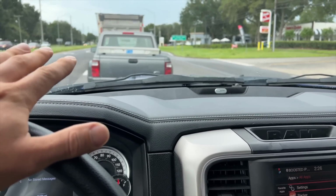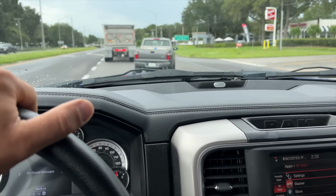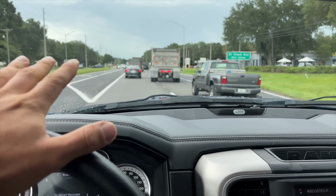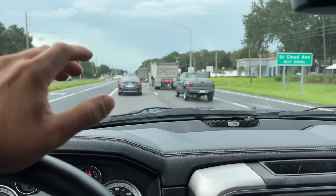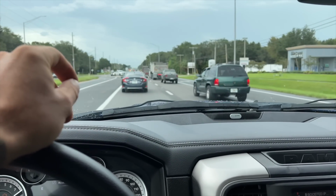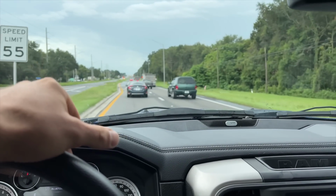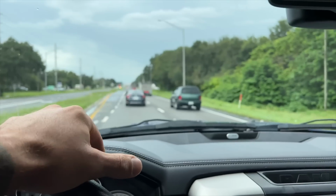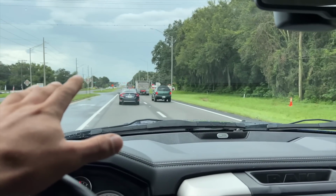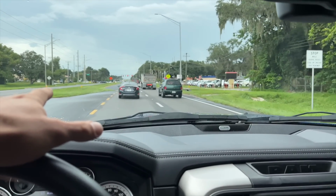The only thing that has changed, you guys, is I installed the catch can. Let's back up for a second. When I had the original blower on, the one with the noisy bearings, I had a PCV line connected to it. Then when I put the new blower on, it had a cap on it, so I just never got around to running the line because I figured, whatever, I'm gonna end up putting the catch can on, and it didn't have a noise. Now, I ended up putting the catch can on, and it's screeching again.